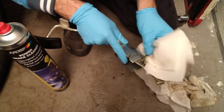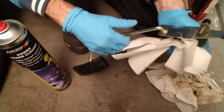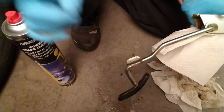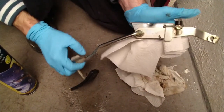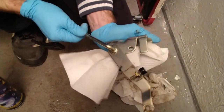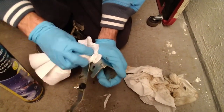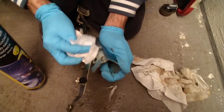You'll calibrate this. This is the calibration. So you have two stops. You have a stop that is in the car still for our full throttle — that hits here. And you have one for minimum throttle that hits here. So we are going to calibrate it, and you are going to help me with that by stepping on the pedal while I work the other end.